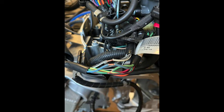On the Honda, the wires involved with the trim pump are blue, green, and a white-black in their wiring diagram. Other motors might use different colors, so you need a wiring diagram to isolate those and identify where the power source is coming from.